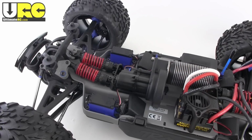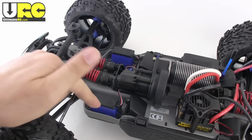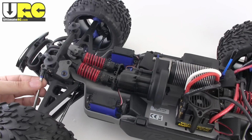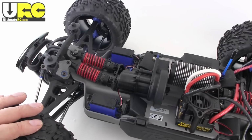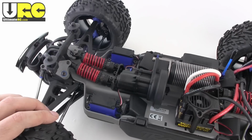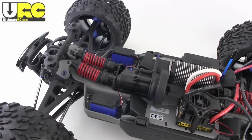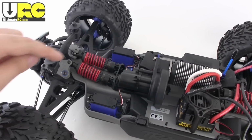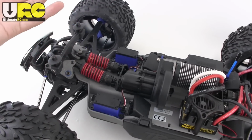That is definitely something that you want to be careful with early on. I'd say before you even run one of these vehicles, check and make sure that these are aligned to each other. Disconnect one of them from underneath, disconnect the linkage, turn the whole thing on, let it arm and see where they settle, and then adjust one of them accordingly, just the linkage accordingly, to make sure that they are together so they're not fighting each other all the time. That's pretty important.